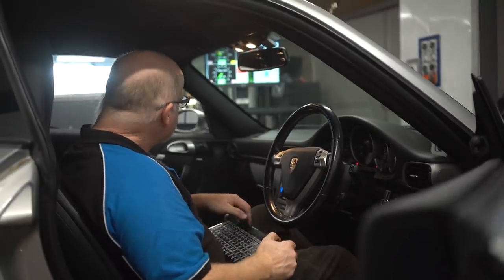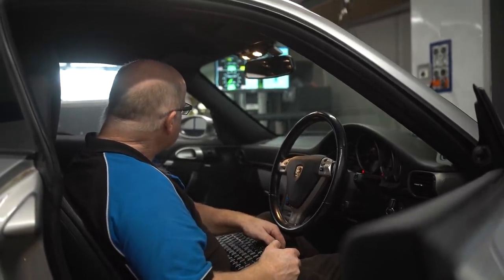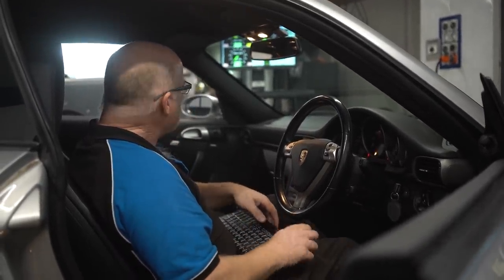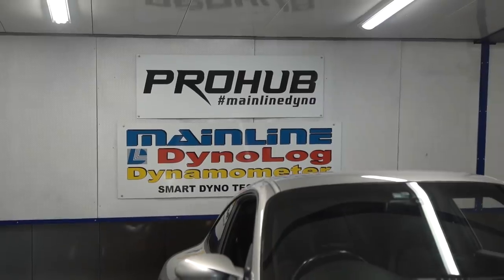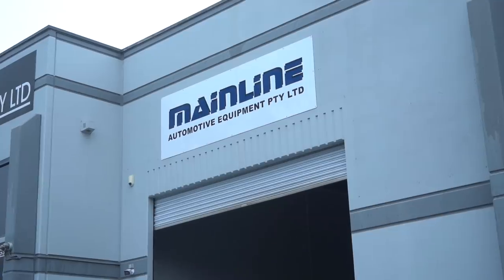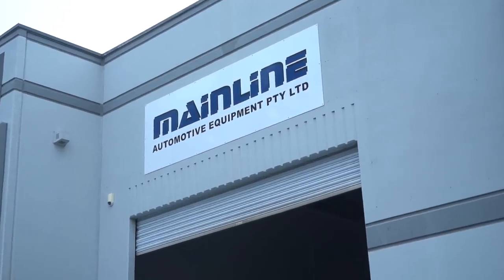This is something that's almost spoken about daily on the internet, like Facebook and that sort of stuff. There are obviously lots of experts who have an opinion because they've tested their car, and that's the number they come up with — but that doesn't mean it translates to every conceivable car. We have lots of data because we test approximately two hub dynos per week at our factory. Our test car, just a VE Commodore ute, picks up between 30 to 40 horsepower from basically pulling the wheels and tires off and putting it on a hub dyno.